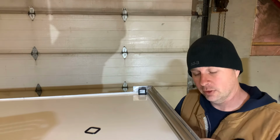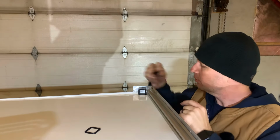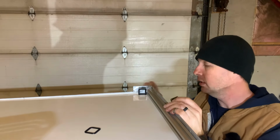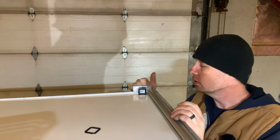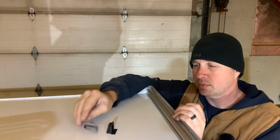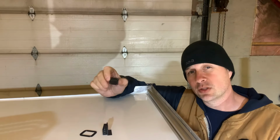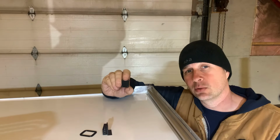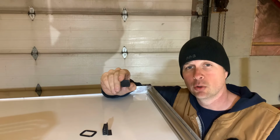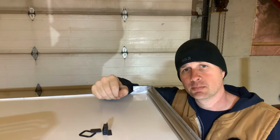Now, how do I get this all lined up in the right place? Well, hopefully, this little jig with four center holes can take its place. I can center punch them, drill the first two from the inside, line it up again on the outside, drill the last two from the outside. Now, this hole doesn't need to be perfect. There is a flange that goes around it on both the inside and the outside, but the closer we get to it, the better. Once the four holes are drilled, I'll cut through with a little buzz saw, so I basically end up with a rectangular, round-cornered hole, and I've made the profile of the corner match my quarter-inch bit.